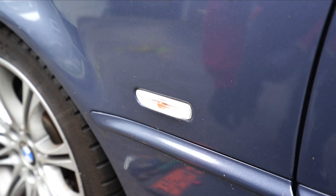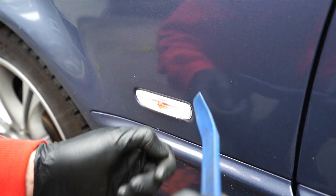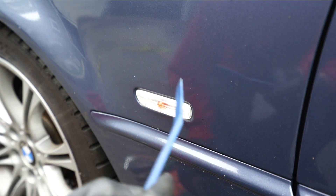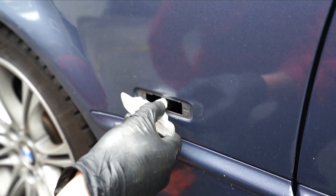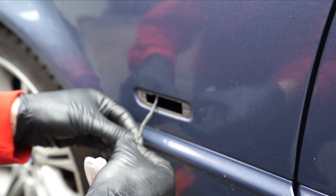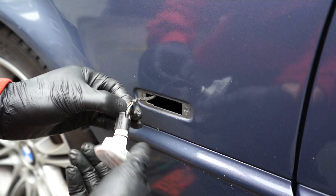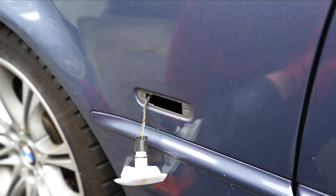To take off the side marker, use some sort of plastic pry tool to get behind it and push — there's kind of a spring piece of metal. These ones are incredibly difficult to get off only because they're brand new. Pull it out, spin it, and then we're going to tap into the blue and yellow wire — you can see it right there. We'll use one of the provided tap wire connectors. Let me show you where the cable has to be snaked down.